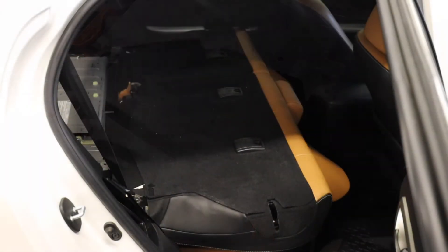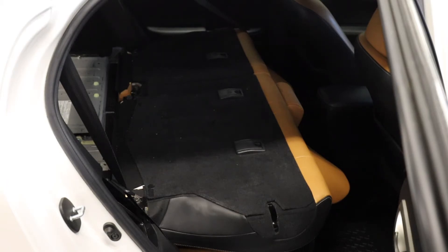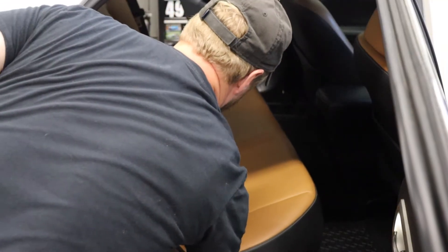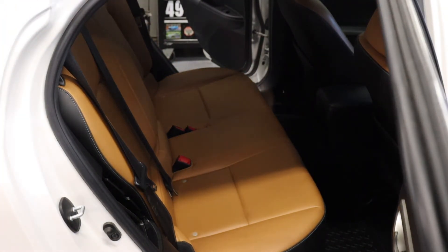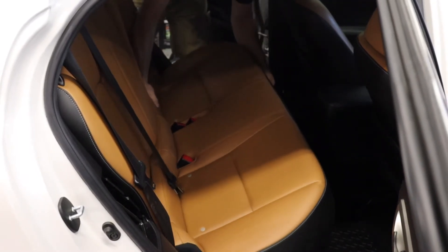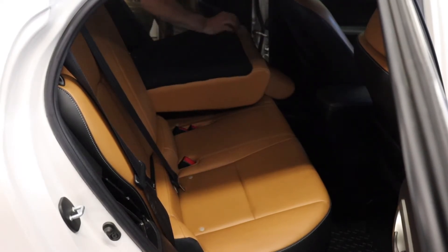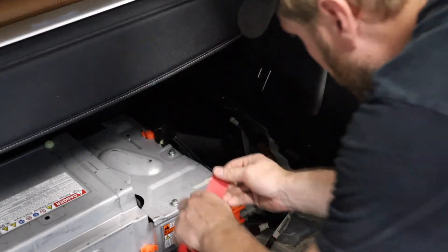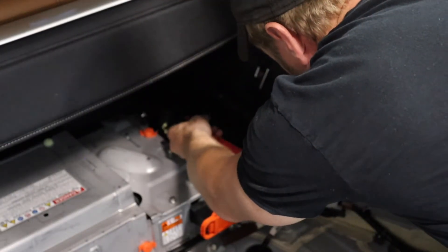Now to get this fan shroud off, we have to access some hidden clips that are down under the rear seat — that's always fun. To pull the rear seat bottom out, it's super easy. If you've never pulled seats out in a car, you just simply grab under here, lift up, pull, and then you can pull it out to unhook it. We don't need to take the seats out all the way — you can just scoop the bottom out. Then come right into here and you will see the clip. We're going to pop that off with the tool. After you're done wrestling with that clip, there's another one — a little more accessible right through the trunk. Pop that right up, and now you can pull this fan shroud right off.